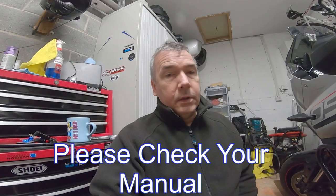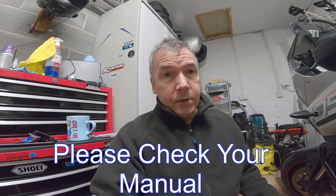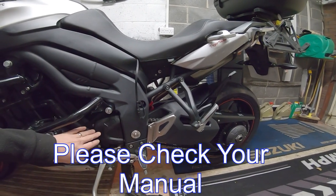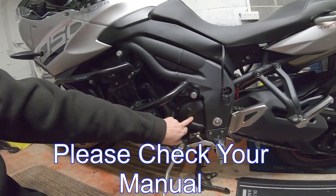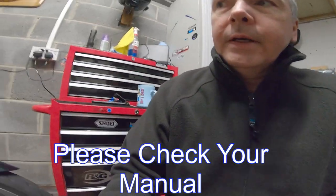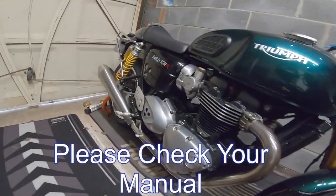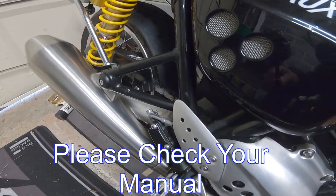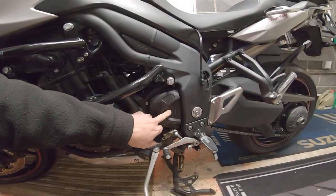This should be the same on the majority of bikes. I'm not 100% sure of this, but I've had two bikes with the chain on this side and the sprocket nut is your standard lefty-loosey righty-tighty. I haven't tried it on one where the chain is on the other side, such as on this Thruxton, but my suspicion is that it's the opposite. So first port of call is to take this sprocket cover off.